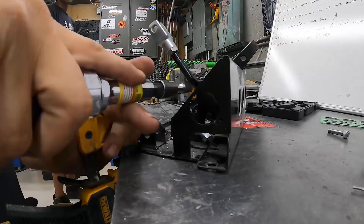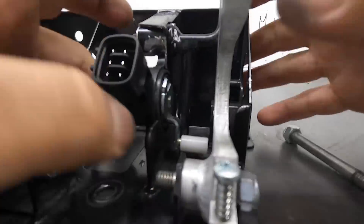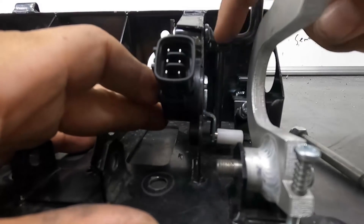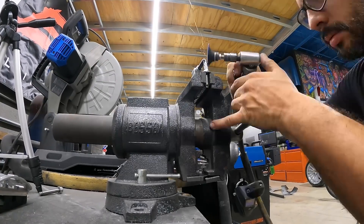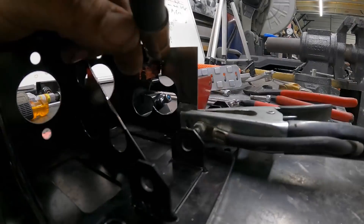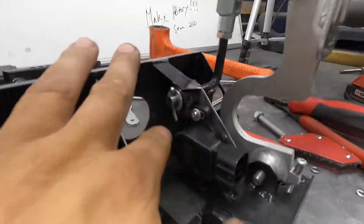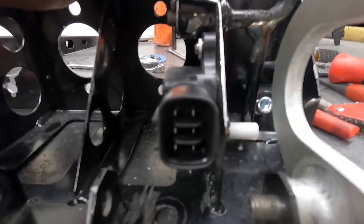Got the battery online. We can move forward to getting the accelerator pedal position sensor mounted onto the mechanical pedal box so we can get pedal position input into each one of the motors. The actuation is pretty good. The rod on the pedal is pushing on the arm, so I'm going to have to cut the post that's actuating it, move it over maybe an eighth of an inch so I can get it riding on the plastic pad and the motion will feel a little better. Got the hardware in here holding the sensor — there's a small amount of adjustment if need be, and it gets the full swing of the sensor so we won't be missing out on any of the range.